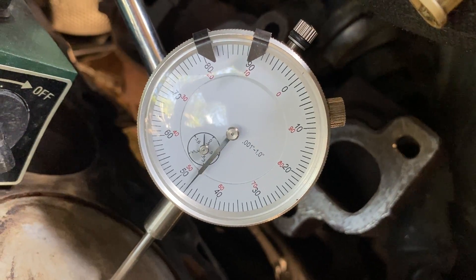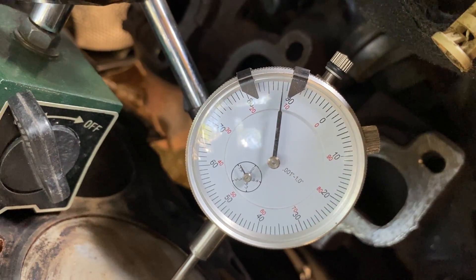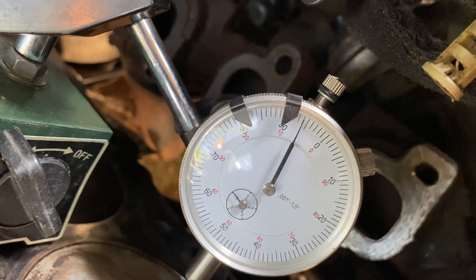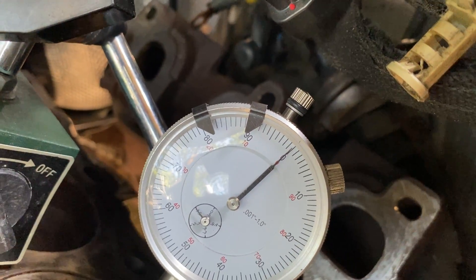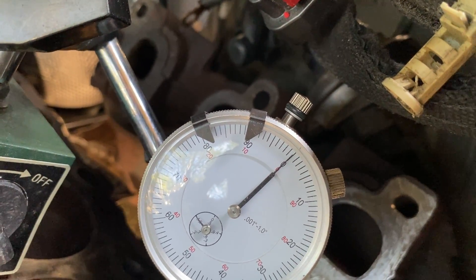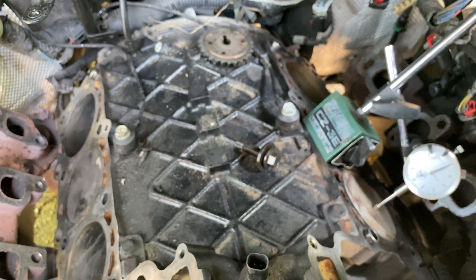Okay, I'm going to go backward. Now I'm coming forward again. Well, I got it pretty dang close. Let me get it right on the money here. Alright, so now I am sure that this piston is at exactly top dead center. And now I can put the heads on and index the cams properly without worrying that as soon as I start it, I'm going to crash the valves into the head.